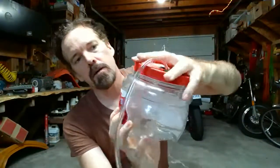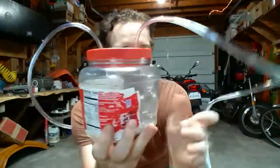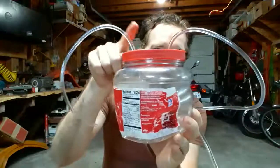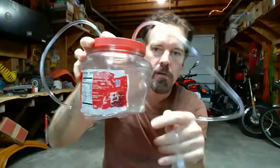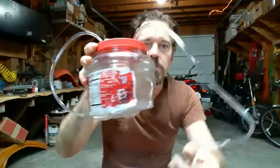The short one stays up where the air is, so as you're sucking on it you're making a suction inside the jar which brings brake fluid in. However, brake fluid will not go out through your air hose as long as you keep the level down below where it doesn't reach that tube inside.